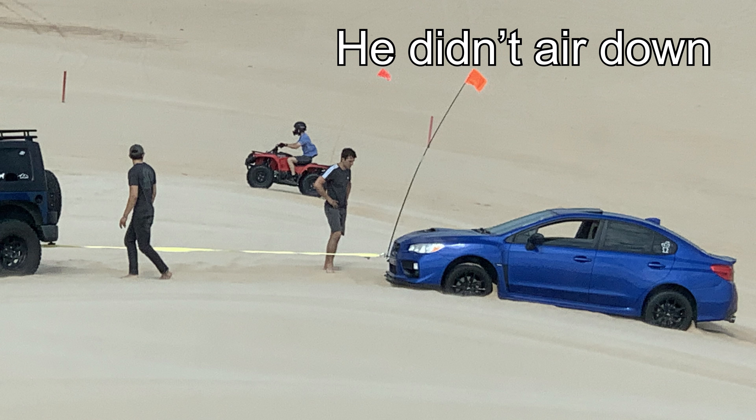The other camp says they're afraid of bending a wheel — I understand that. But we'd much rather be concerned about the longevity of the vehicle, and if we have to replace a rim then we do. As far as airing down on sand, we go down to 10 pounds — you can't even move on sand without it. I'll be doing a video on that later this year at the sand dunes.